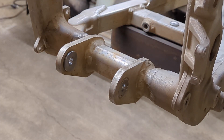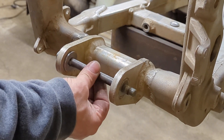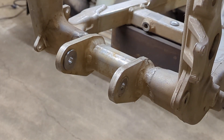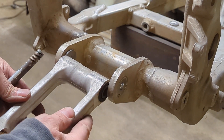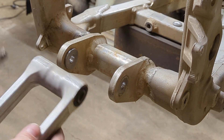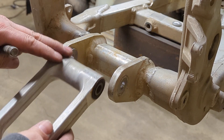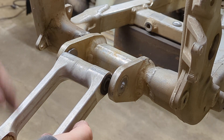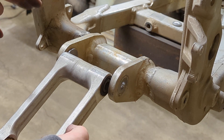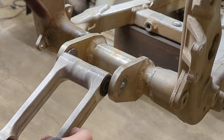Both sleeves are in. You can see now the bolt's got a nice tight fit — it's not going to go anywhere. And our linkage fit piece is going to fit in there real nice and snug. I'll just tap that in there with a dead blow hammer. I'm going to grease all the linkage pieces. This particular set of bearings was in really good shape, but the bearing back here and the swing arm bearings are all worn out — they've gotten a lot of water in them — so I'm going to replace all of those with new seals and then put this back together.